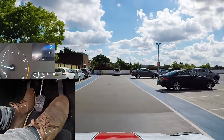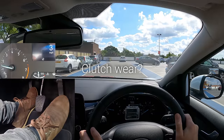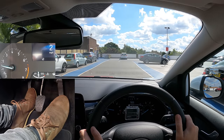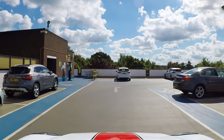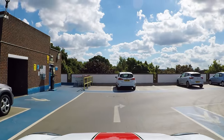Understandably some new drivers are worried about wearing out the clutch. With use, some car components will wear out over time — eventually even a clutch. But holding the biting point for about three seconds as you creep is what it's designed to do. If you often hold the biting point for long periods of time then you are going to wear out the clutch quicker.